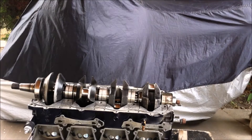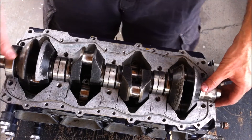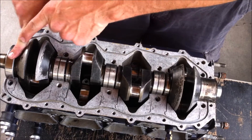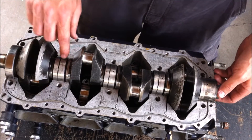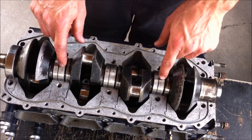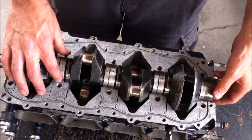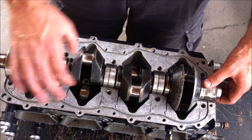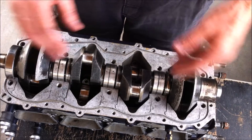I got the crankshaft into the case. It took a bit of wiggling. I found it was best to start with one side kind of seated, then slowly work it in. There are guide dots on the other side indicating where the bumps — the locating pins — sit into the set holes. The seals are pointing down on their end gaps.